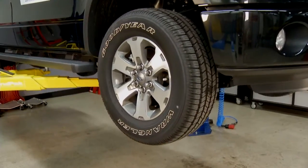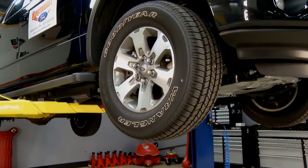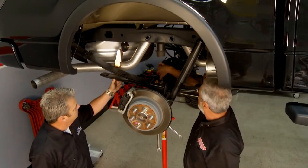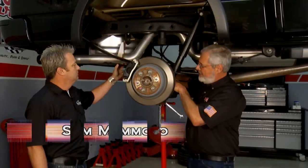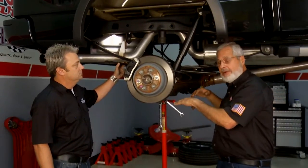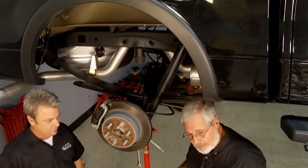Welcome back to Motorhead Garage with Kelly, continuing our 3-inch lift kit on this F-150 — a brand-new truck. Following the instructions, one of the first things to do in the back is deal with the ABS speed sensor wire. Since we're going to be taking the shock off — which limits the travel of the differential axle — we don't want the axle to drop down and pull that wire and break something. Pop the little clips out like an upholstery clip.